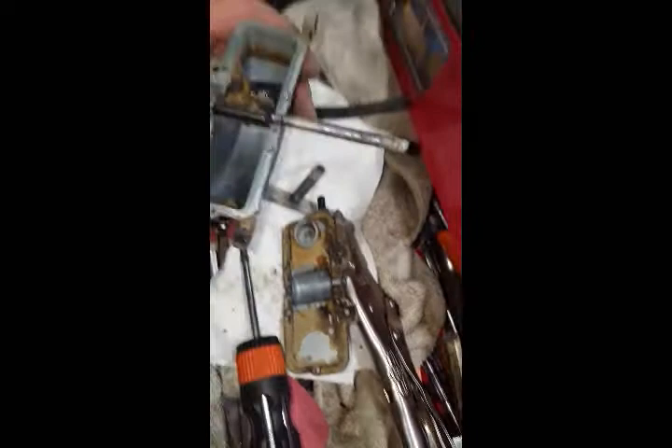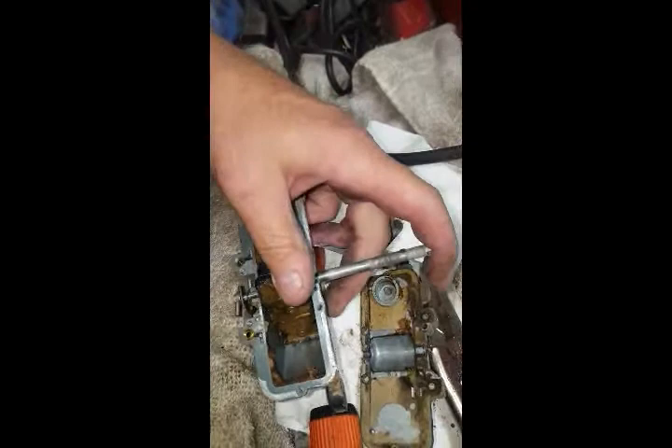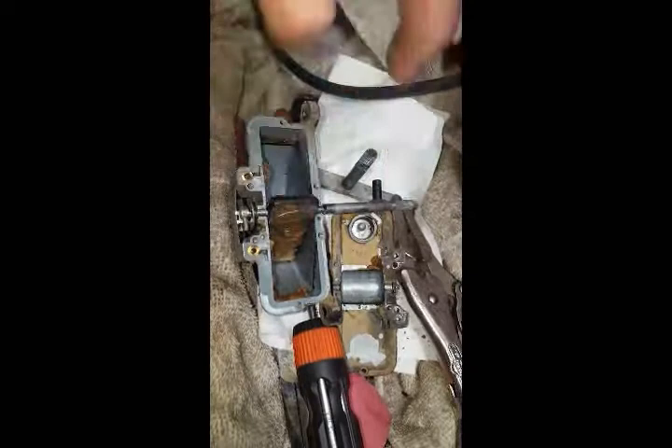You can see how this wiper moves down and around inside there. It goes back and forth and you can see the wiping action that it will do. This is the main inlet right here, free vacuum coming out. As the wiper moves to one side, the valve changes and it pulls vacuum on the other side, which allows it to pull the other direction.